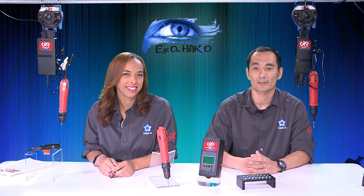We have different options, so let's break down the different drivers. To break it down into two big categories, we have brush drivers and brushless drivers. The big difference between the two is that brush drivers use carbon brushes for the action — they produce a little bit of carbon dust — whereas brushless drivers don't use carbon brushes, so it's virtually maintenance-free with no carbon dust and a little bit more efficient.